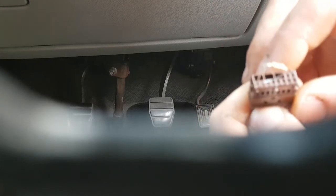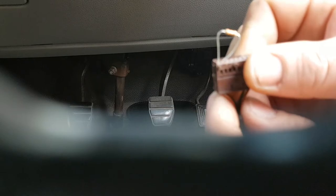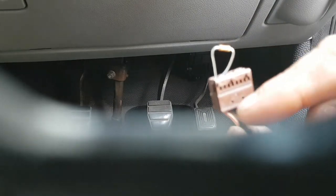All I'm doing is poking it in the ends — you see that there. You see the ends here? I'm poking it in on either side. You need to join the wires with a resistor — one either side — so you're joining the white and red and the brown and red with a resistor. The best thing to do is snip the wires so the resistor sits between them and tape them up, or you can just poke it in like that, bend it over and tape it up. It's up to you, but you do it like that so you've got the resistor on both wires.